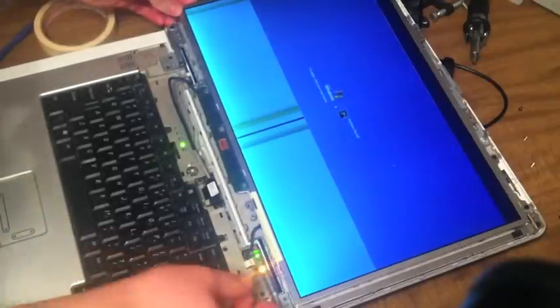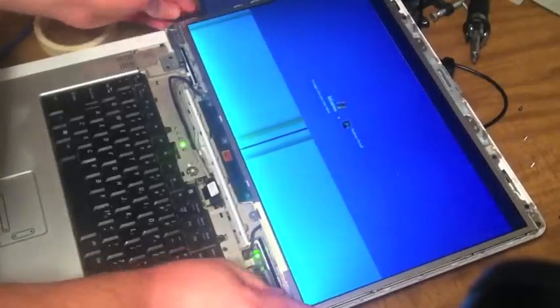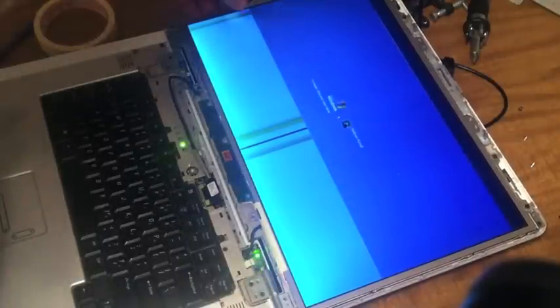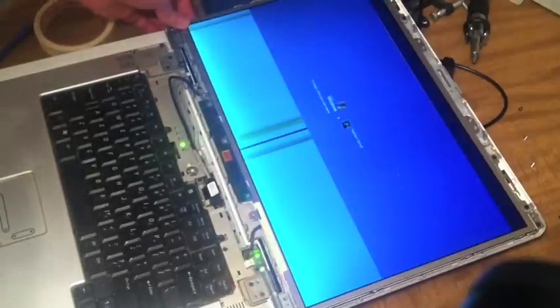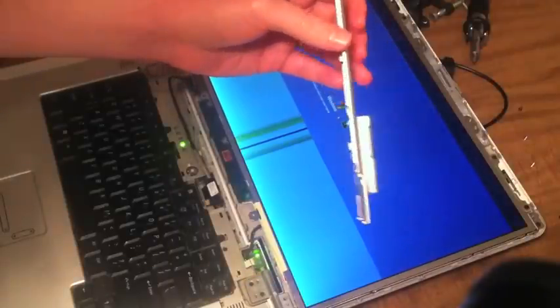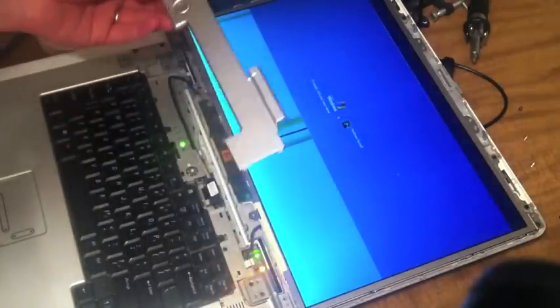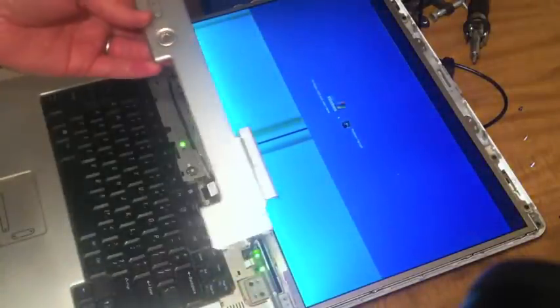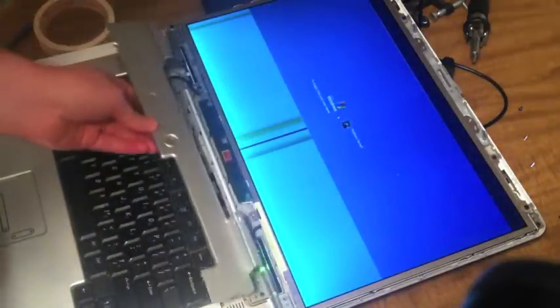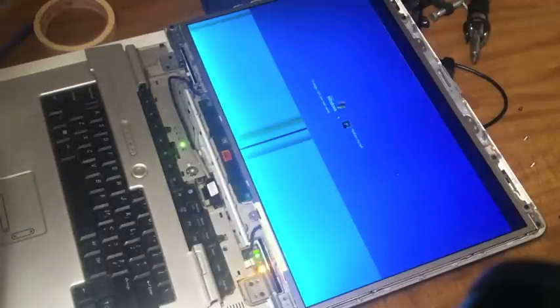Just an update: after I thought it was fixed, the lines came back before I could shut down, and now I cannot get them to go away, no matter what. I've tried playing with it, pressing over here where I had the C-clamp — nothing works. So I did some Google searching and it looks like this is a common problem with the Dell Inspiron 9300. So I probably can't get it fixed. I think I'm just going to give up at this point. If anybody has ideas how I can fix it, let me know. I could buy a replacement screen, but that's like $80 and it's probably not worth it on a 10-year-old laptop. So I'll probably keep it around — it would be possible to use it with an external monitor — but I think I'm going to give up trying to fix the screen for right now. Alright, hope this video helped. See you next time.